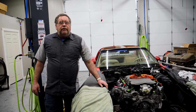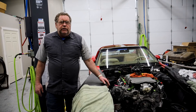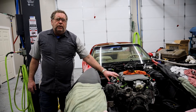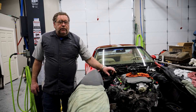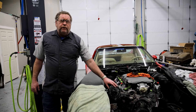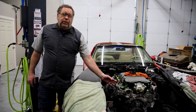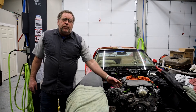A couple of the other issues that I've run into in trying to locate parts for this is the harmonic balancer on this engine is different than the harmonic balancer on a wet sump engine, and it is very difficult for me to find a harmonic balancer that is going to work to line up this drive belt, or accessory drive belt system, with the new water pump.